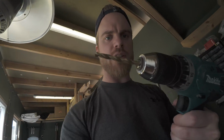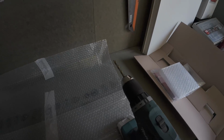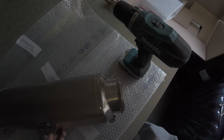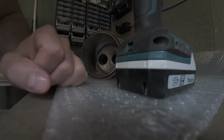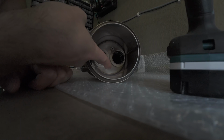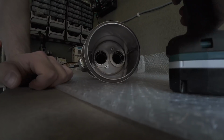So I took a 6mm bore head out of my Makita case, and actually this is just the one for steel, so it should come off quite easy. So I'm gonna put you down, and I hope that you're gonna see that correctly. I'm gonna drill out that one first, that rivet, and see how that comes off quite nicely without damaging the exhaust that much. So let's see.